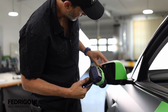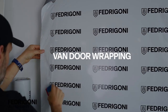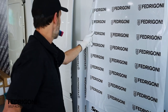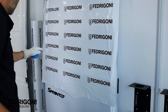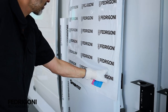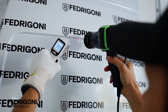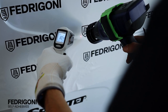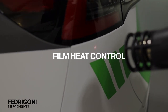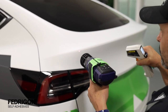Be sure to add heat on all the edges to activate the adhesive. ReJet C50 Ultimate is very conformable, meaning it can be applied to deep recessed areas commonly found on vans. Standard installation methods can be used when forming the film into the deep channels. Note that the low tack of the adhesive plus the air egress allows the film to easily apply to the flat area once the recessed channels are formed. At the end of the install, it's critical to post-heat certain areas up to 90 degrees Celsius to reduce the memory factor of the film and help ensure a long-term hold. Always use a heat gun and an IR thermometer, focusing on all deep recessed areas, edges, and any overlaps.